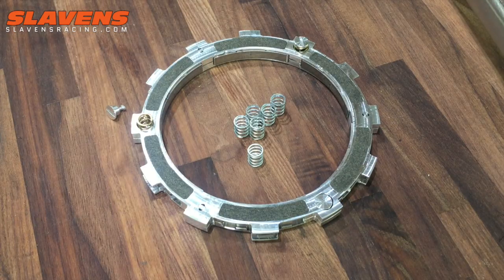Lay the bike down on its left side so that you don't have to drain the oil. Unless your oil is dirty, you can just leave it upright, but it's actually easier to work on the clutch when the bike's on its side because the parts don't try to slide away from you when you're installing it. Before that, I clamped the vent line on the gas tank. On fuel injection bikes and carbureted bikes, you should do that. On a carbureted bike, you're also going to get a little bit of gas that leaks out of the float bowl, plus you need to shut the petcock off on those models. Fuel injection bikes don't have petcocks.